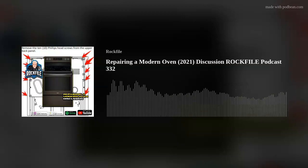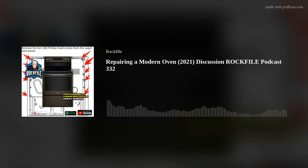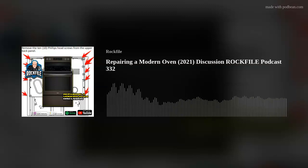Amazon, two days, the part arrived. It was one of the front two burners because those are the ones that get used every day. The back burners hardly ever get used. The first burner has a different kind of switch than the other three because it's kind of the brain of the operation. So I started with the other front one — and that was the one. Took that switch out of line, turned the stove back on, no lights. Hooked the switch back up, turned the stove on, the lights came on. Okay, this is the bad switch.